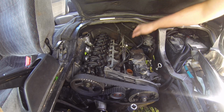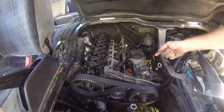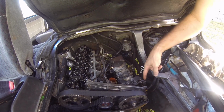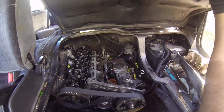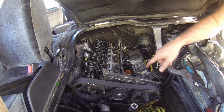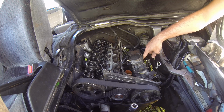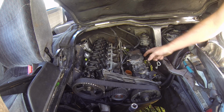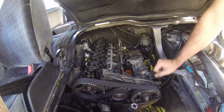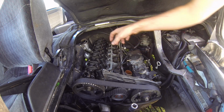So to prime the pump, you're just pressing down on this bit here and then you're letting it come up. So start off with the fuel, where the fuel line comes out there, pump it till the fuel comes out that line, put that on, and then you're going to tighten that up and then pump it until fuel comes out the overflow of the pump, which on this one is there's all hoses at the back here, so there was no nut to loosen them off or anything. It just automatically has a return line, it seems. And then the final bit of bleeding will be you have these loose and you crank the engine until fuel starts spraying out, and you can tighten those up.